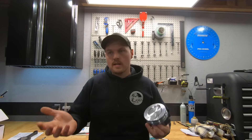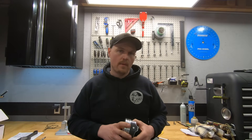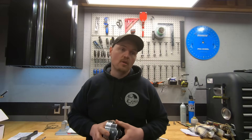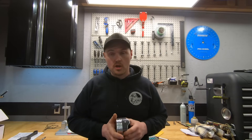A lot of guys building these motors are trying to save money, and getting things balanced is expensive. So if you're using a stock crankshaft and you have the stock rods and you're swapping pistons, there are ways you can get around balancing. But if you're swapping in an aftermarket crankshaft or doing a stroker that hasn't been balanced — you can buy balanced kits — but if you bought a crank here, rods here, pistons there, you don't know that bob weight and you're going to want to get it balanced for sure.